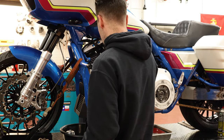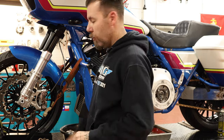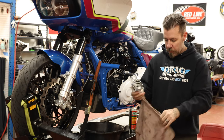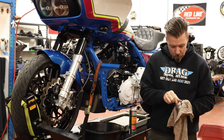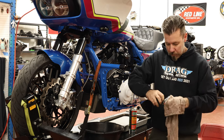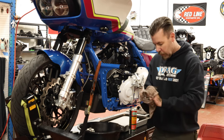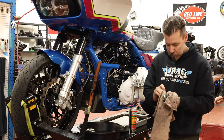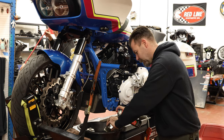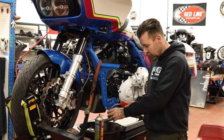You'll have to go back and clean up any oil that drains down the front of the motor — it's just part of it. I'll walk you through the process of cleaning this Flow oil filter. First, wipe it off really well to get some of the oil off the outside. The filter has a magnetic pickup on the inside as well. You push it down — it's spring-loaded — then twist it and it'll pop and come out. There's a spring in the bottom. I'll wipe this down and wipe out the magnet, which had just fine material on it — normal, especially for early break-in stages. Spray this guy out, spraying from the inside out to get rid of any debris.